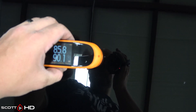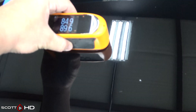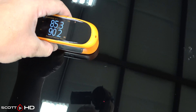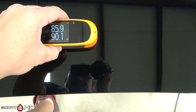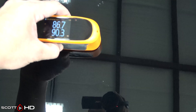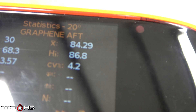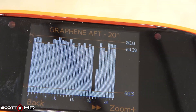Here are our gloss readings — we're taking about 25 to 30 readings. Originally we were in the upper 70s, and now we're getting into the mid to upper 80s, so that's a gloss improvement you would definitely notice with your eye — not just the defect removal but the actual gloss. Our final average came out at 84.29 gloss units, and you can see on the graph there were about two lower outlier readings, but we're solidly in the upper mid to upper 80s.